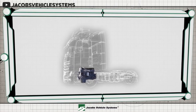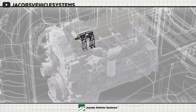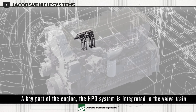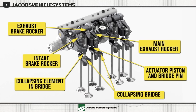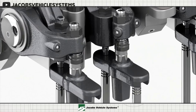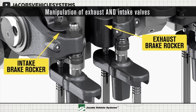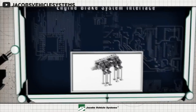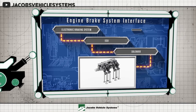With that in mind, you might wonder why simply shutting off the fuel wouldn't work as an engine brake. In a gas engine, closing the throttle body creates a pumping loss which, combined with the natural drag of the engine operating, provides engine braking. But for a diesel engine, there is no throttle body, so your only option would be to shut off fueling — and unfortunately, shutting off the fueling wouldn't create any engine braking at all. There's no pumping loss because air is still able to flow in and out of the engine freely due to the lack of a throttle body. Something like an exhaust brake can create exhaust back pressure to generate engine braking, but in its normal state, shutting off fueling won't create engine braking in a diesel.